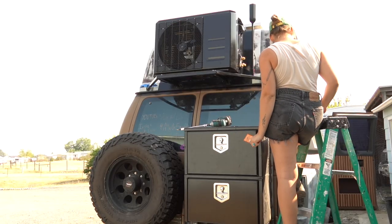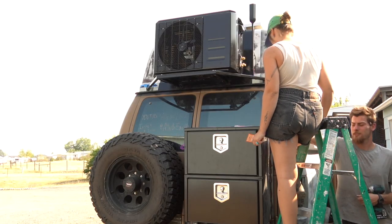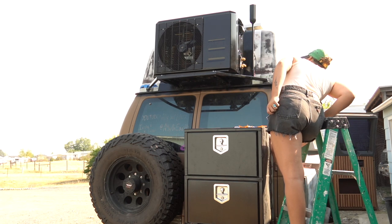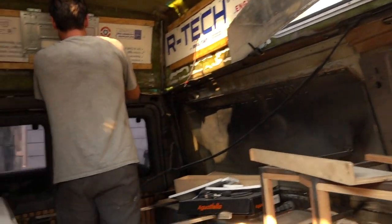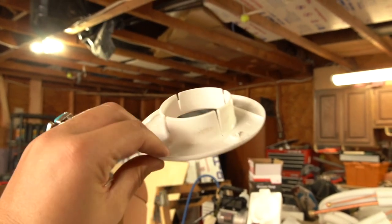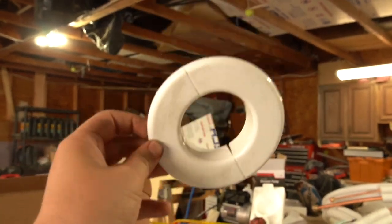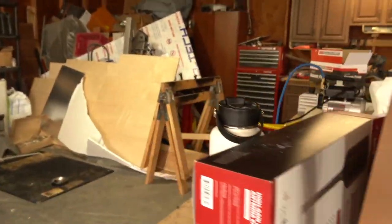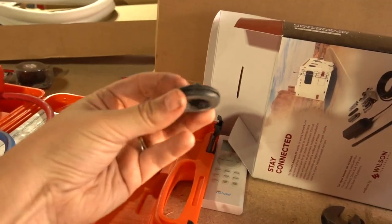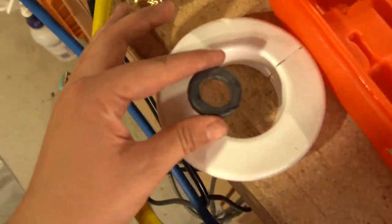Oh it's so hot in there. Not for long — let me see that impact with a little urgency please, let me see a little less attitude. Is that out? No, that should be good. You think you could put a washer and that nut on? So they gave us this sleeve to run all the wires and piping through, but yuck. You're supposed to just put spray foam around where the wires aren't, but it's a van and we want to have it as tight, clean, and leak-proof as possible. So we got these little grommets — like a rubber seal — and you can see it'll just go on there. We're probably going to have to drill two holes.